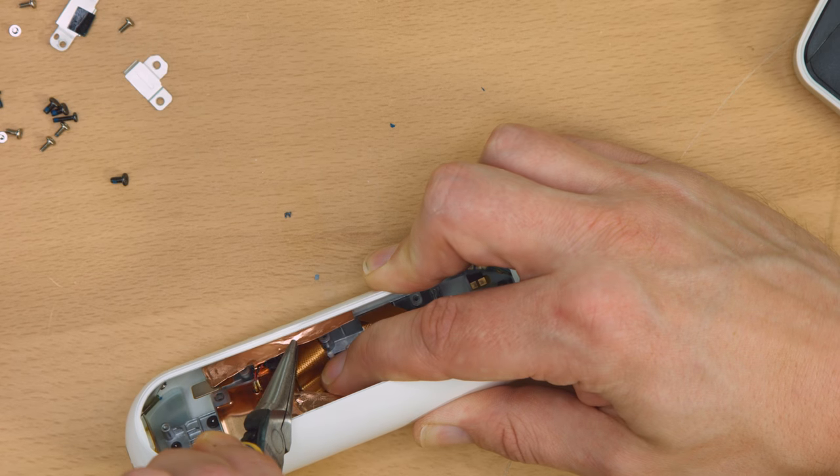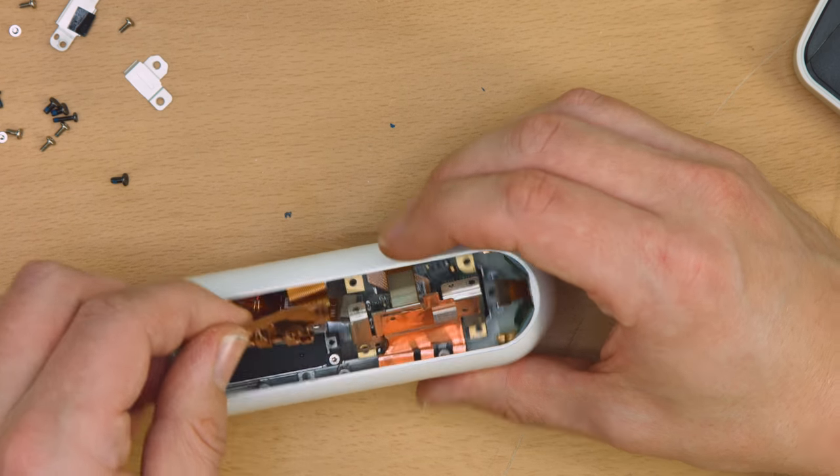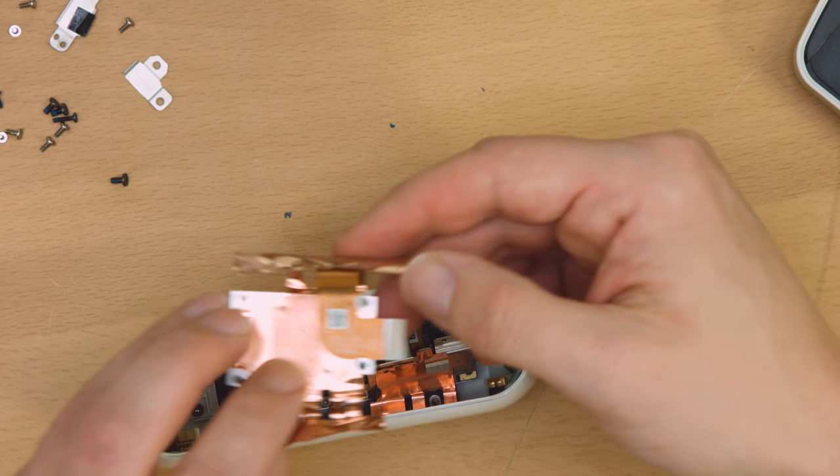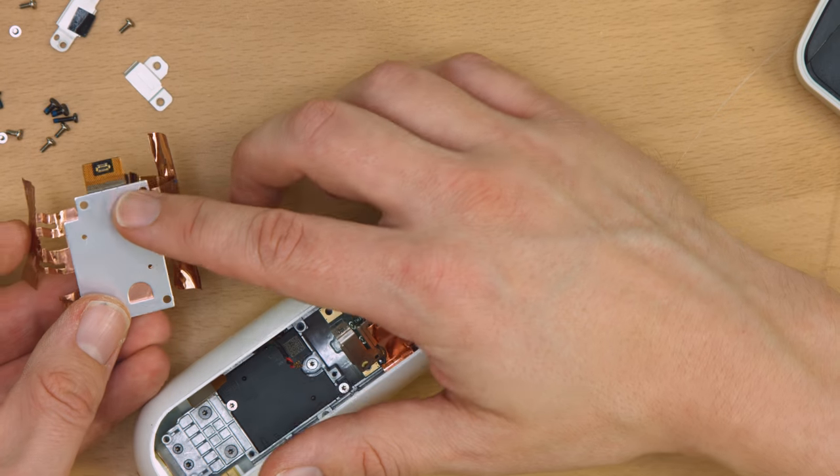It's not just because of the copper foil, but because of the final aluminum support structure at the very bottom of all this. Now out comes the aluminum plate to which one section of copper is bonded. Also on there is the cable which goes from the LED board to the power module at the very back of the unit.